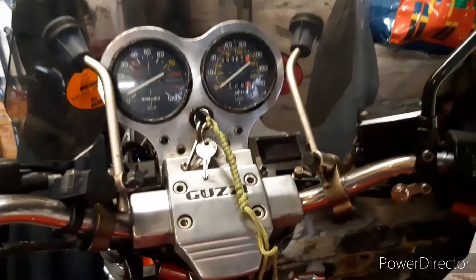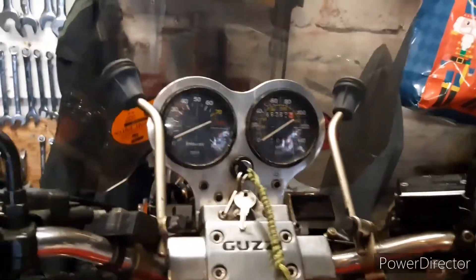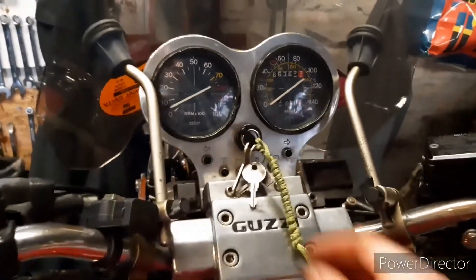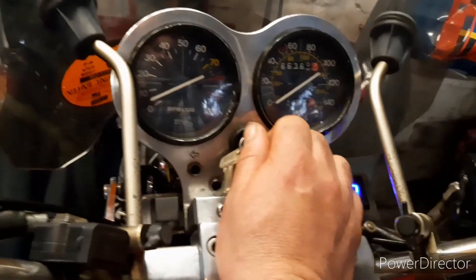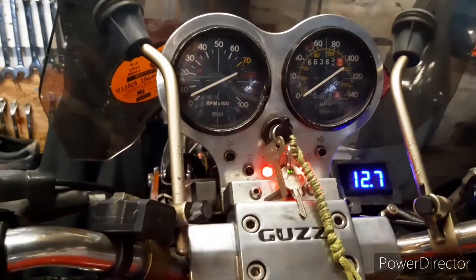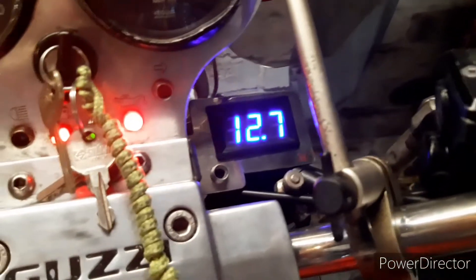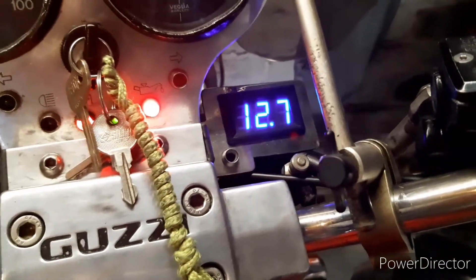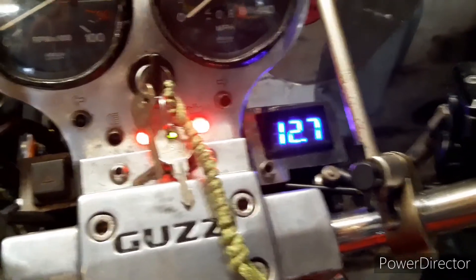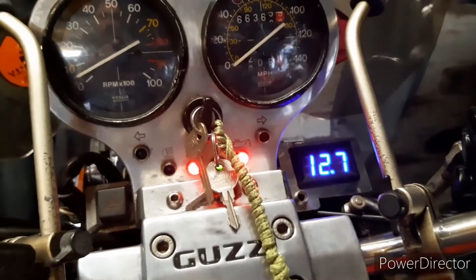One of the most obvious and best uses for the voltmeter is just to do a no-load battery check. So we're just going to let the bike sit — it's the morning, we're out touring — and just check that the battery is still charged up from the night before. You can see it's 12.6, 12.7 — that's not too bad. The battery is in good condition and it's fine. Now if you start to notice that's going down day after day, you know you've got a drain. So before you even start the ride you can do a quick check and make sure everything's okay.